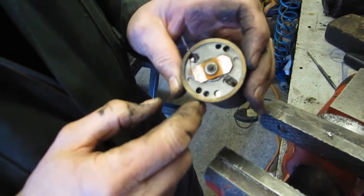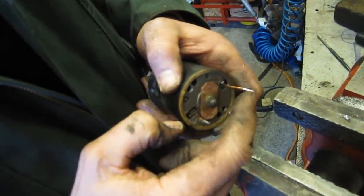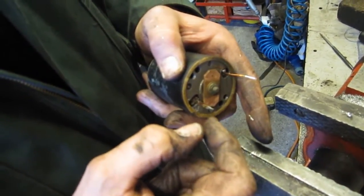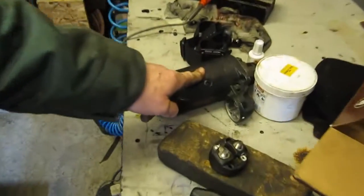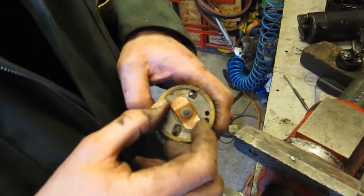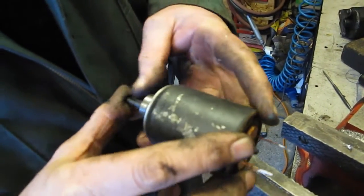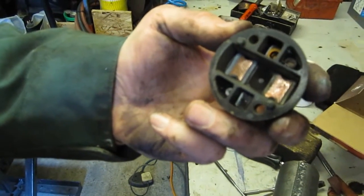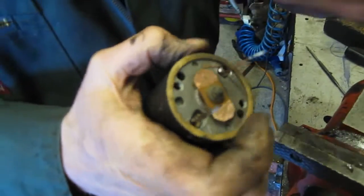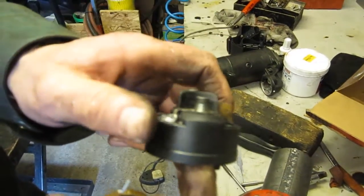This is a coil of wire, and when we push the starter button this coil of wire becomes energised by feeding current down here. It's a single coil of wire — it goes in one end and comes out the other, and then goes to earth through the armature of the starter motor. When that happens, this becomes magnetised and attracts the iron plunger in, which pulls the lever at one end and pushes this plate into contact with the plates inside. This plate bridges those two contacts — it joins them together and passes current into the starter motor itself.